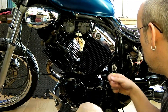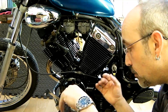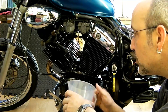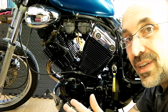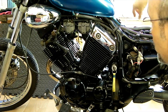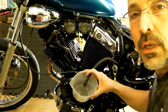As I stated in the previous video - incorrectly - the marked output of the Virago fuel pump is 50 to 60 litres per hour, not per minute. We need to do some calculations to figure out how much fuel it should be pumping in 30 seconds, which is a reasonable test duration. If results aren't positive, I'll unplug the power feed - a simple two-pin connector - and apply 12 volts DC directly to the pump so it runs at full rate regardless.